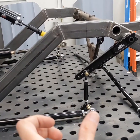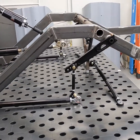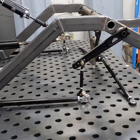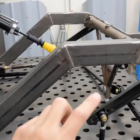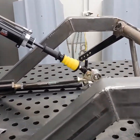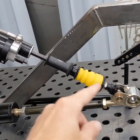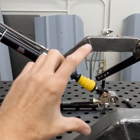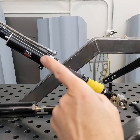It lets the tires time to grip and catch the chassis up to speed. Because this is a road race car we don't want soft sidewalls — we want really strong sidewalls so that lateral control is nice and predictable. But ideally you'd like to absorb some of that shock, and what it does is give you a lot more traction under throttle. Under braking the opposite happens — this is a gas-charged shock with settings for compression and rebound.